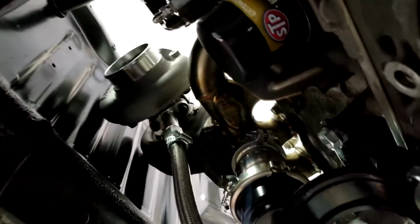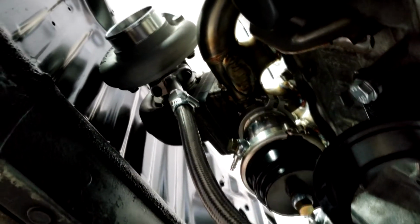So you just need a straight hose. You can either make your own, or there is another hose out there from an '87 Dodge Caravan that will do it. It's been a known mod in the MR2 community for quite some time. So everything else underneath here looks good. I only have it on these two motor mounts on the sides, since those are the ones that hold the weight. Everything else is for movement back and forth. So yeah, everything is done here, and let's get to work buttoning this up.